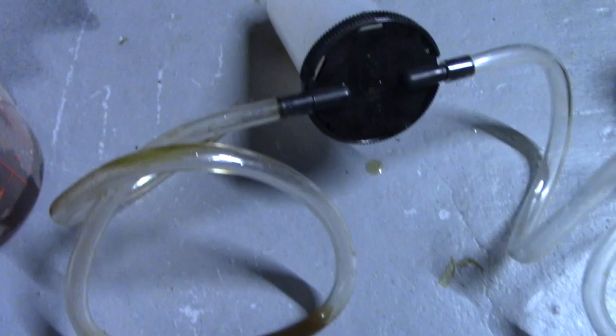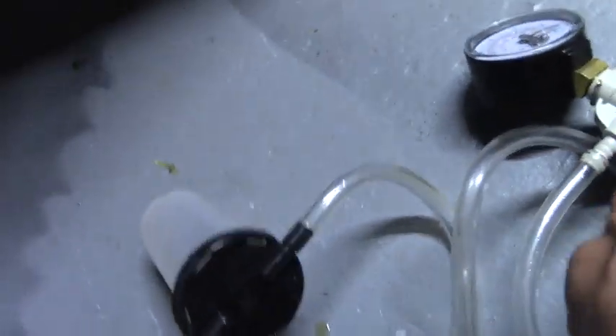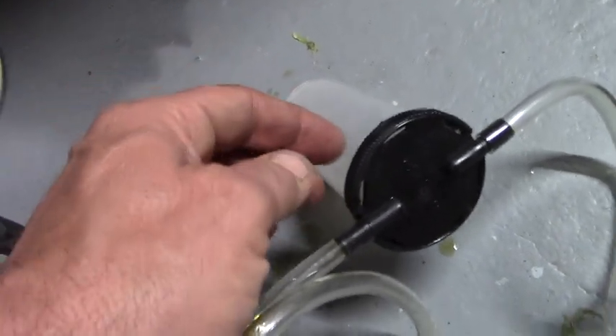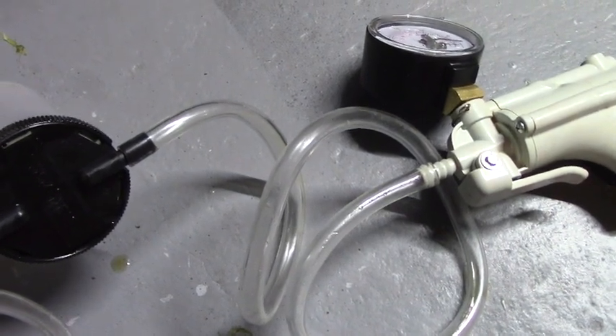So this is coming out. I'm sorry I didn't document every single part of it — I took off the lid and drained the fluid. You'll need one of these: a vacuum pump for sucking out brake fluid. You follow the instructions — pump it, hook up the hose, put it in your reservoir and squeeze the handle. It builds up vacuum which sucks the fluid into the cylinder. Once it starts to get full, pour it out and keep going. You can use it later to bleed your brakes too.